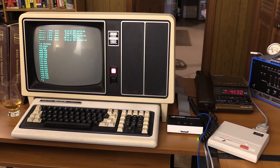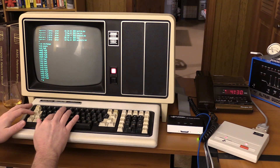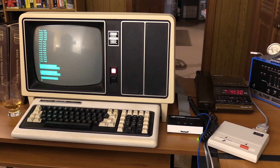Things like VI do not work. There is no clearing the screen or anything really — it's just not going to go. And when I'm done and I want to hang up, all I have to do is hit CTRL-D. You might faintly hear the click of the modem behind me cutting off. And now I no longer have carrier detected, so I'm just going to uncheck the connect button. And there we are.